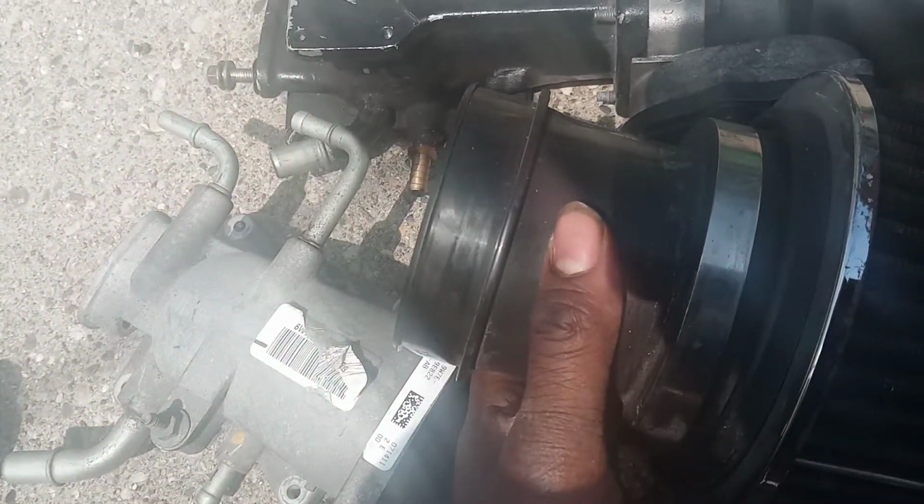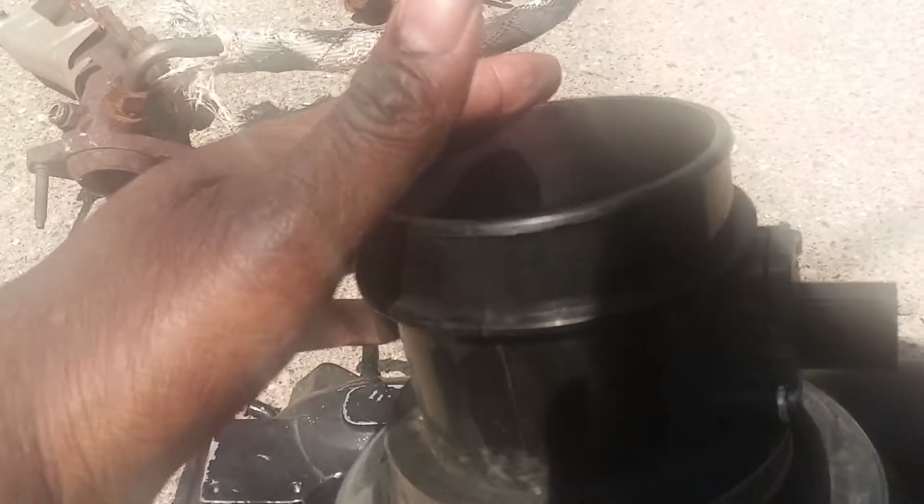And as you can see, the MAF housing goes right in there. This is this filter. I don't have the specific name of the filter that I bought, but they do have them on eBay, and it comes with a couple different innards. That way you can properly size the MAF housing that you're putting in there. And I just used a simple piece of hose for the crankcase. That's either the crankcase or the PCV, so don't get me wrong on which one that is.